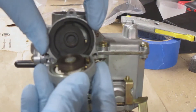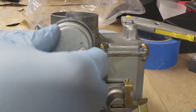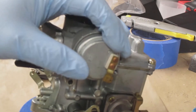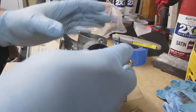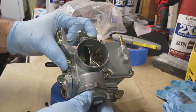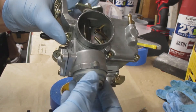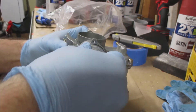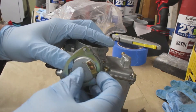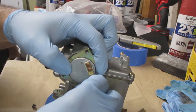There's the choke, and it has a spring that heats up and then functions properly. When the choke is on, the butterfly in the carburetor channel closes, or stays closed more so than when it's warm. As the engine heats up and the carburetor heats up, the butterfly gradually opens. So when it's cold it closes, and when it gets warmed up it's fully opened.